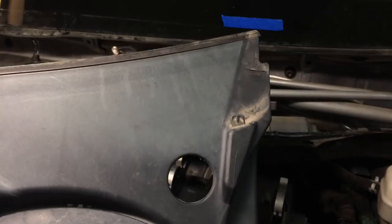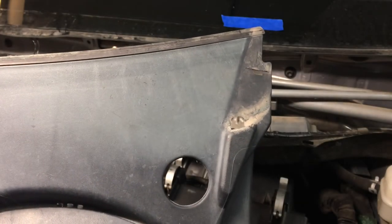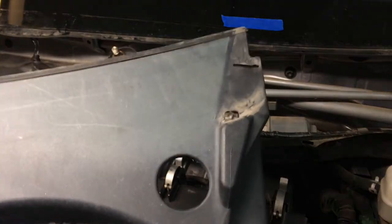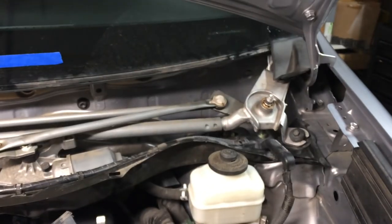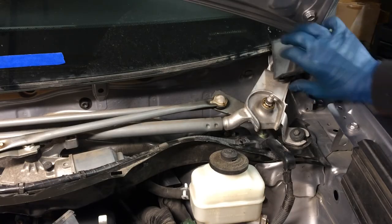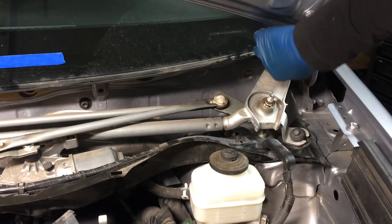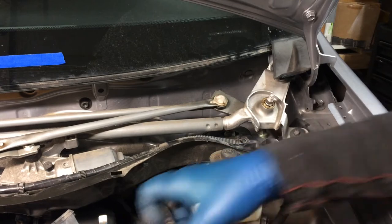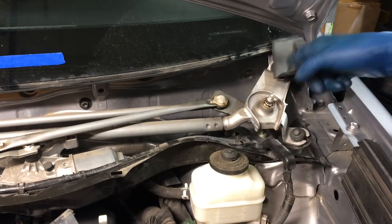Now for this upper cowl, the plastic one. And on this end, you can see there that one square part. That's where we're going to have to get that square part lined up with that little clip there, right there. So behind it, there's also kind of a slotted deal that goes to that slot. So looks like we might have to put it in place and then lift these up and snap it down.